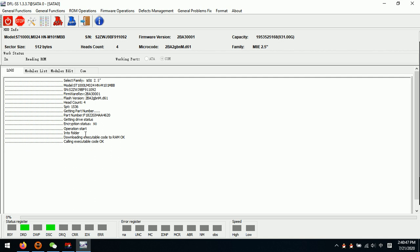After backing up the ROM, we can try to check the head map. For Samsung hard drives, it is a very common case that one of the heads is weak or damaged. In that case, it is necessary to use the head map editing in ROM function to get the hard drive ready and imaged properly. Now we just need to wait until the ROM backup is complete. After the ROM backup completes, we go to ROM Operations and click Head Map Edit.